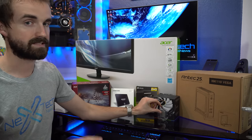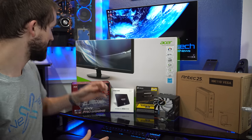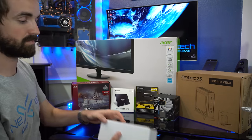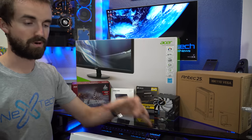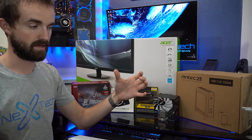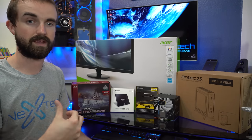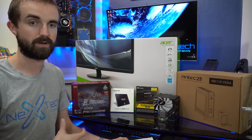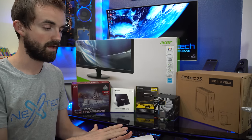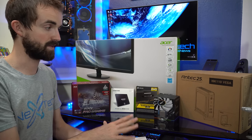And she really needed to stay under a specific target wattage for load wattage because the power supply is kind of a unique power supply that I ordered. You'll see part of it when I start building: a little logic board that plugs into the 20-pin and then the 4-pin for the CPU and everything. And then part of it is like a laptop charger. So it's 144 watts, and that's what I had to stay under for this build.